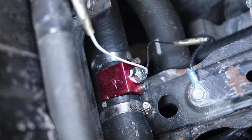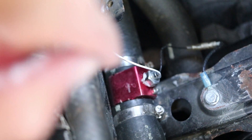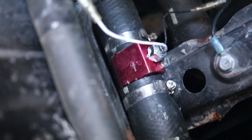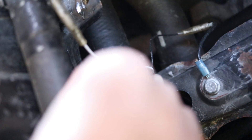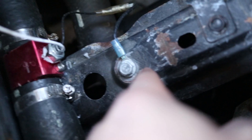After the battery tray is removed, you'll be able to see this hose that runs over here. You remove the piece that's in there — that piece looks like this. You just remove the little clips on it, pop out the hose, and it comes right out. Then you're going to replace it with this thing — it is a 36mm adapter. You just screw in your water sensor right here, ground it to this bolt right here, and then run it through the firewall with the other sensors.